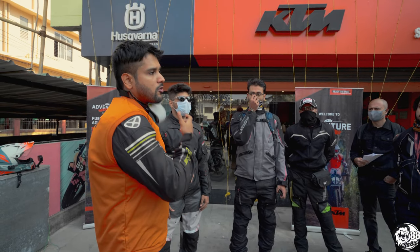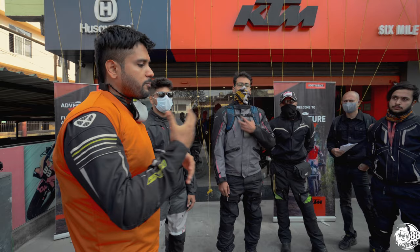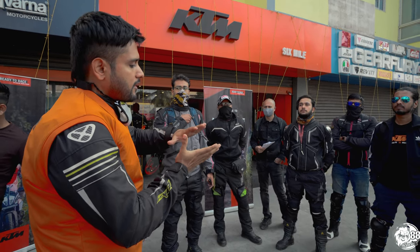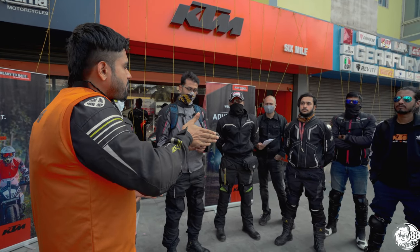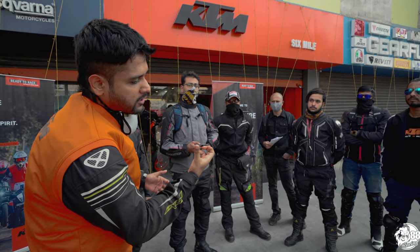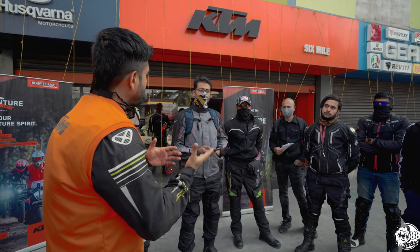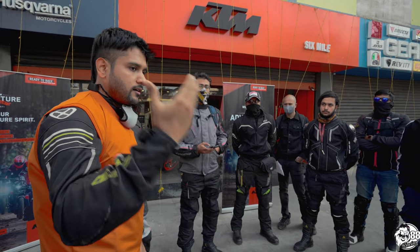On normal bikes, when you run into a corner and brake, you're asking too much of the bike and the brakes. The front tends to lose out, or if you have ABS, it straightens your bike up, so when the ABS activates you run wide into the corner. This bike has cornering ABS. That means that even if you brake going into the corner and your front loses traction, the ABS would activate, but it won't make your bike go wide. You'll still be able to make that turn while keeping yourself safe.